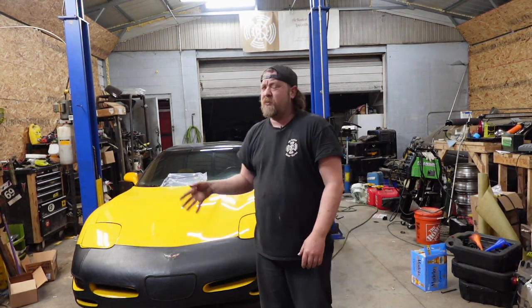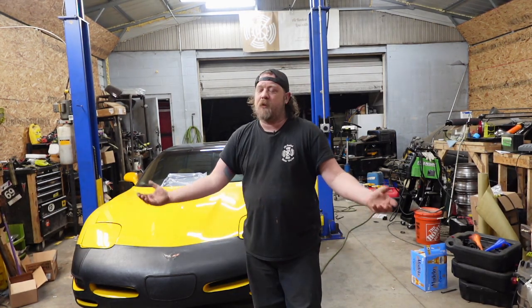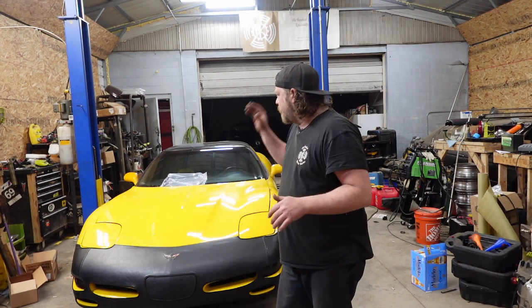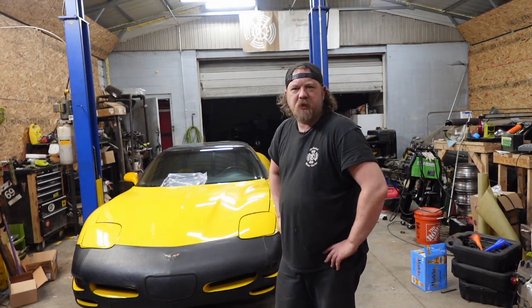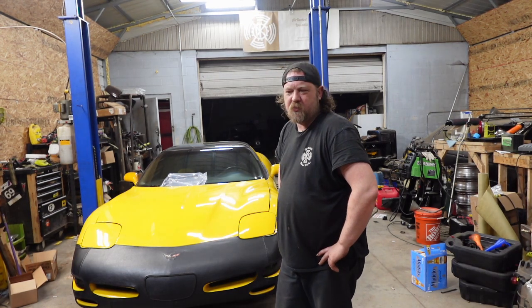Pretty sure, I threw my borescope in there, and it looks like a stereotypical oil pressure sender or cam position sensor, back in the block, behind the intake manifold. Gotta remove everything. So what I'm gonna do is replace those sensors. Hopefully the oil is gonna stay in the engine, which would be ideal, and not have to farm this out to do a rear main.